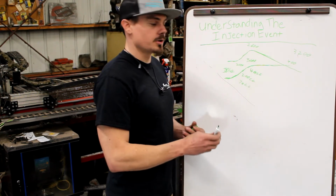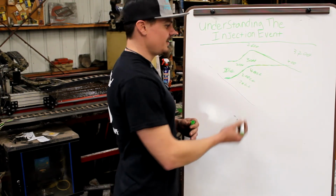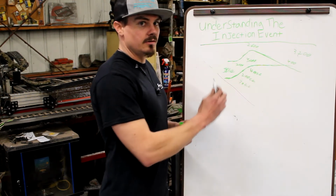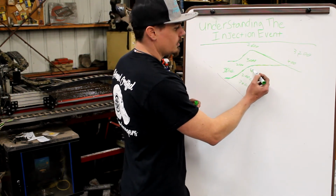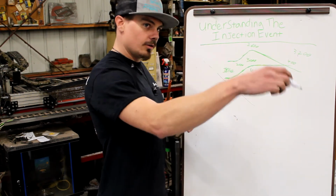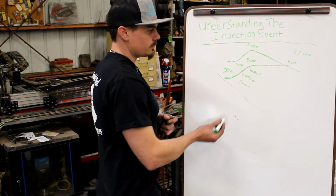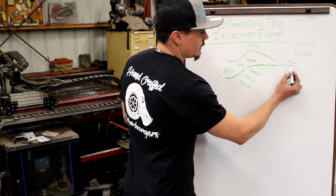And now because we're a turbocharged system, that would cause a lot of black smoke. Because the turbo is probably at 5-10 pounds of boost, and our AFR is not correct to burn the 200 cc's at that window. So we typically roll it, and while we're rolling, RPM comes up, and then we're at 300 cc's, and it's a domino effect. Stuff gets crazy, goes real fast. So just like turbochargers have capacities, so do injection pumps. So that's important to note too, is where is your max CCs at?